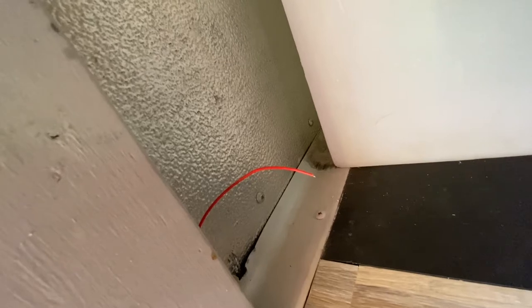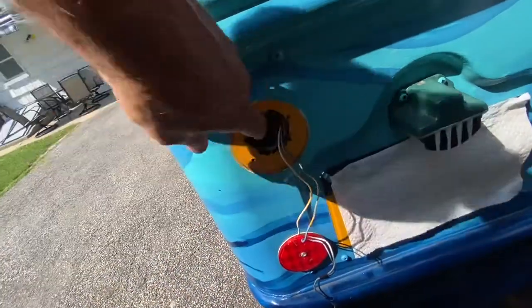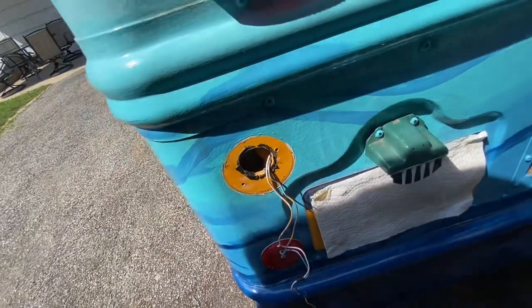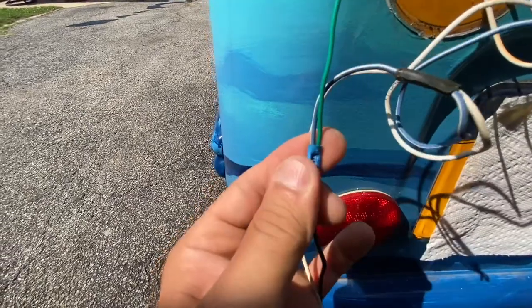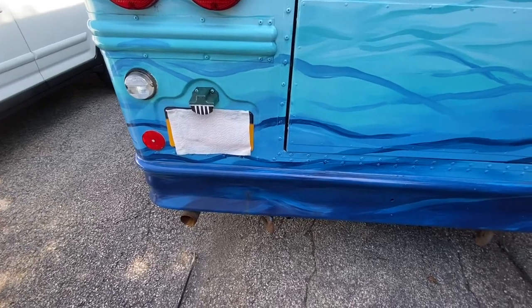We have the red lead from the camera that you need to hook up to a reverse light to give you the parking guide lines on the mirror. The water tank is in the way and there's no access to get to the wiring through there, so I slid the water tank forward and popped out one of the reverse lights. I drilled a hole at an angle so we could fish a wire and hook into the reverse light. Cut off the old solderless terminals and twinned in the wire for the reverse light signal. The light is all back in and sealed up — and I found out it had water in it anyway, so it was a good time to fix that too.